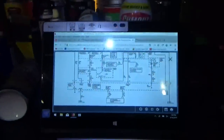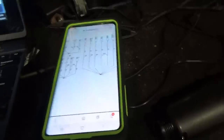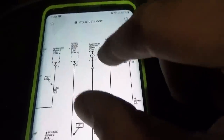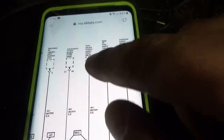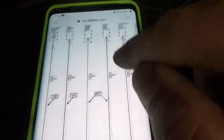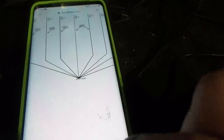We're basically done. Now G105 — let's look that up. On G105 we have a whole bunch of stuff: ignition control module, secondary air, transmission control module, park-neutral position switch, mass airflow, and PCM. That is a key ground. Let's see where it lives.